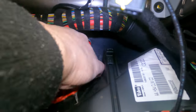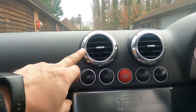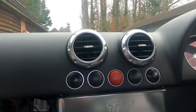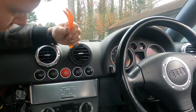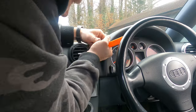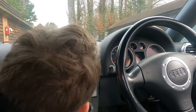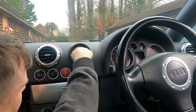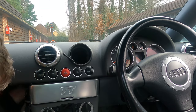So now back inside the car. Put that grommet back in — there is our vac line. Which vent are we going to go for? Let's go for that one. I popped it off and the little ring came off straight away. I need that to come off anyway, but it came off a little bit earlier than I thought it would. With the vent out, it's time to find that vac line as I'm feeding it up with the left hand and pulling it out with the right hand. Found it, pulled it through. Job done.